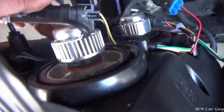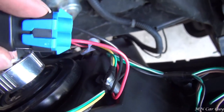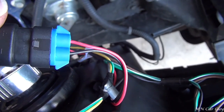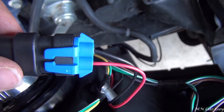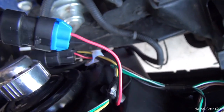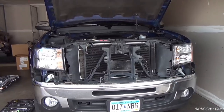I happened to guess correctly when I put this one on since the lights came on. But if you look at this one, this notch is only on one side, and the clip - the harness that comes with the lens - is actually installed backwards compared to how the clip is meant to go. Which is just dumb - it's a manufacturing error. There's nothing I can do about that except the redneck fix of using electrical tape. I don't like to do it, but it's what we've got to do. And there we go - there they are side by side.